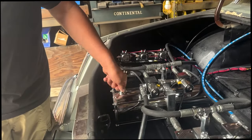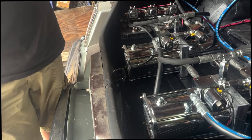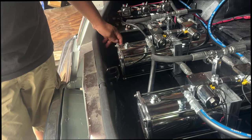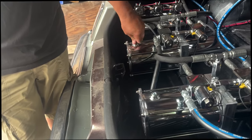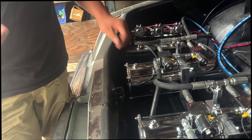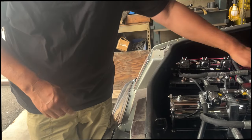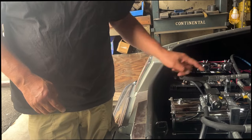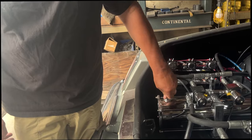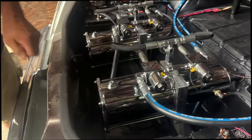These are hand tight. Some people want to tighten these all the way, because as you're driving around, the oil moves around in there like a washing machine. You might get seepage here. It's better to get seepage here every now and then than to tighten this all the way. You have your level here, and the rest is air. Air gets hot, air expands, pushes down on the seal that keeps oil from going into your motor. I'd rather have seepage than burn up the motor. Common sense, right? So they're hand tight so the air can breathe in and out instead of building pressure. See what I mean?